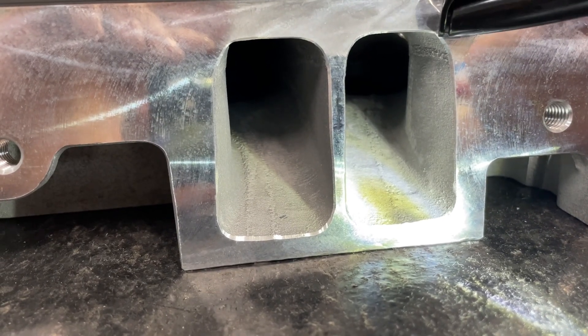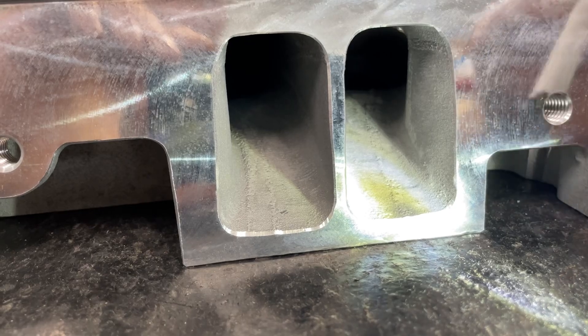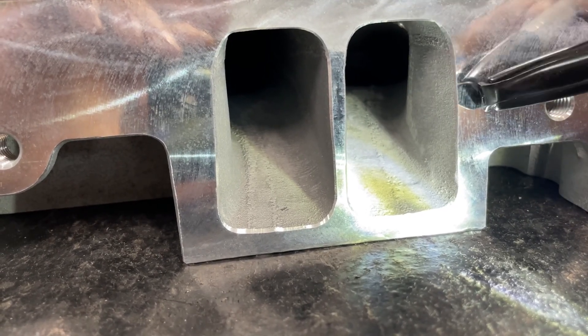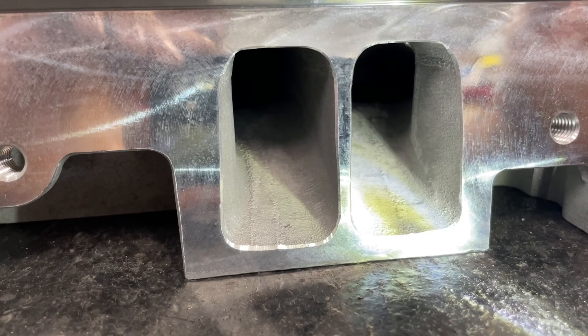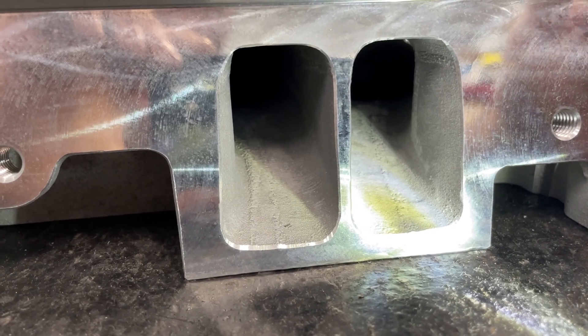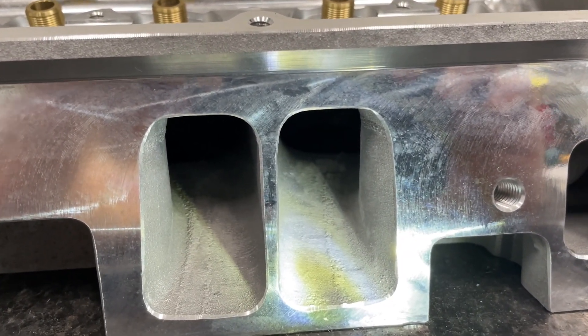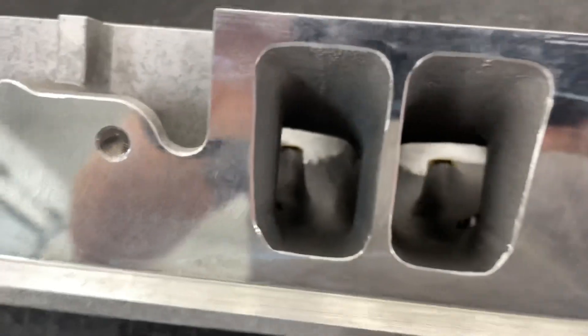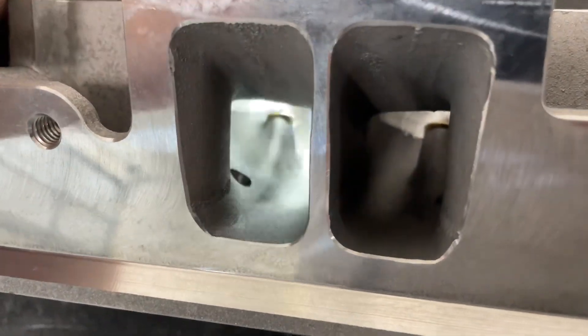One thing I have to say about this head - and all Profiler heads really - when you get them from the box they're rough. If you get a Brodix they're all CNC gasket matched, and I think Dart does now too, but these aren't. It's not horrible but it's not perfect. It's fine and shouldn't give any issues. This head is 1.206 - you'd think with the head this small it'd be a 1.205 but it's closer to a 1.206 entrance. I'm going to flip it over so you get a better view of that lump I was talking about.